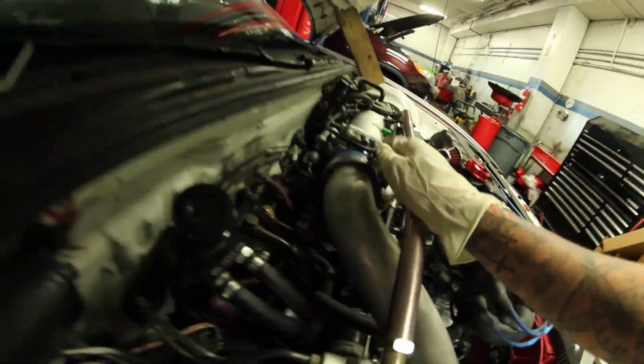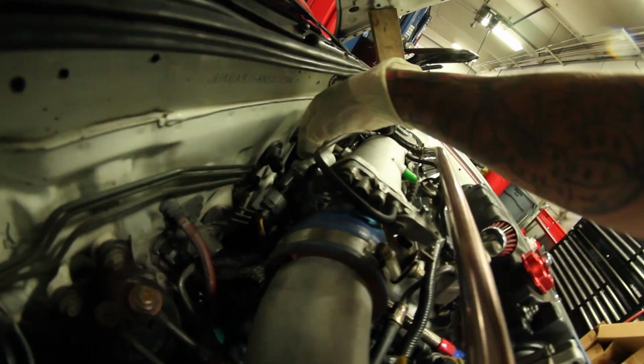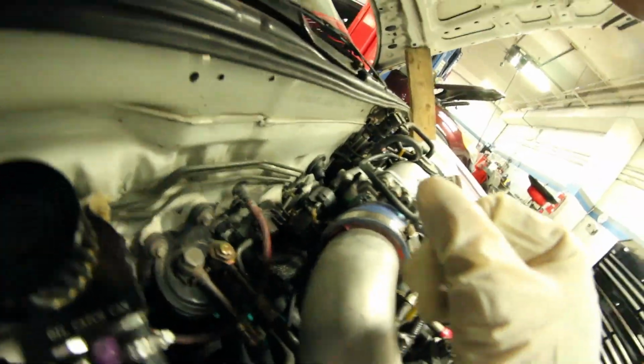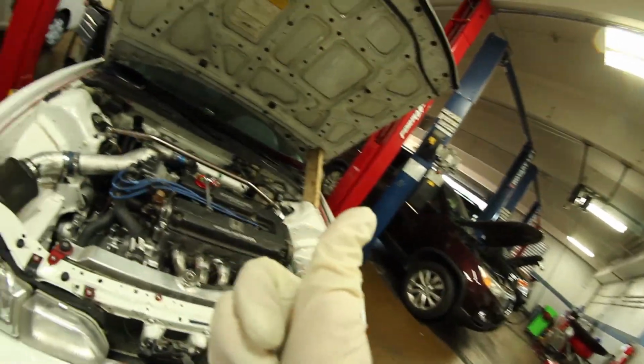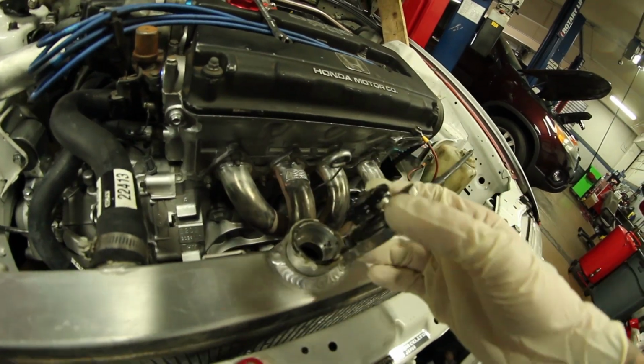Alright, so for this, I'm gonna take the intake tube off, disconnect it, and the electrical connector. And you got 2 12mm bolts down here on the back, and then 2 hoses, so it'll all just come right off and then literally just snaps right back in place. And then got a bleeding cooling system, so should be good to, yep, so cool.